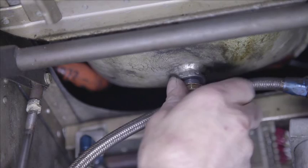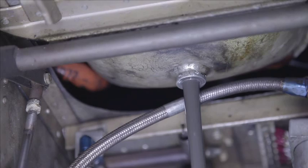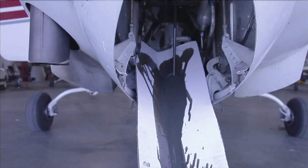Keep an eye on the oil as it runs down the cardboard and watch for any abnormal chunks. If you see anything suspicious, make sure to find it and identify it. This is your chance to identify pending engine problems, so take advantage. If you plan to take a sample for analysis, put your bottle into the stream of oil after a quart or two has run out and catch an ounce or two.